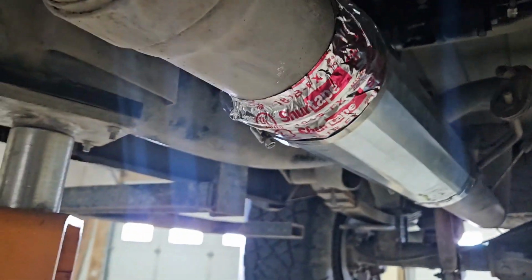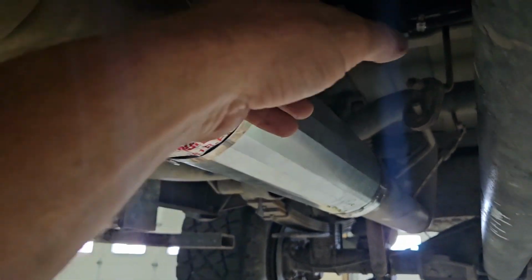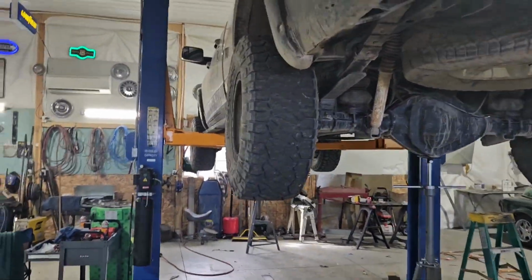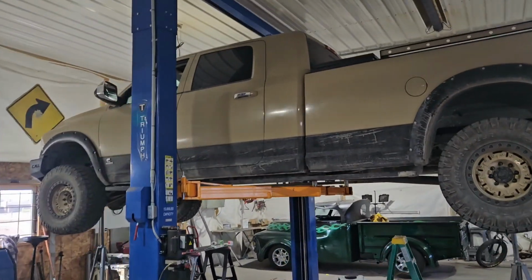Now what I'm going to do is take my air hose and connect the air hose to the other end of that garden hose, charge it with a little air, open that valve for just a second or two and then close it. That will put positive pressure in that vessel and it's done. And then I'll clean up my mess of antifreeze and stuff I've spilt everywhere and lower it down. And that is my diesel fuel heating vessel thing.